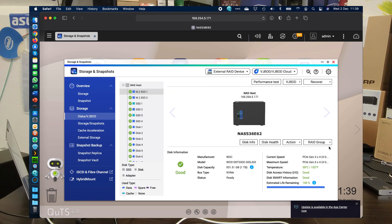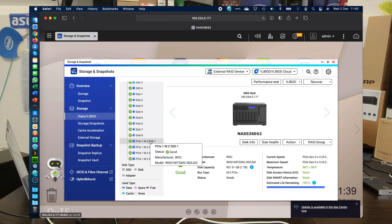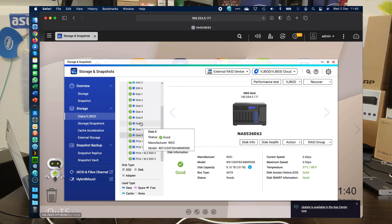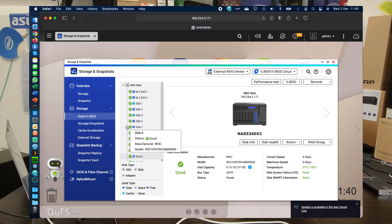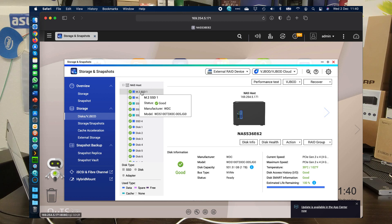Going into the discs, you can see all of these different groups together. We've got four NVMes on a dedicated QM2 card, all in one RAID array — that's a RAID 0. Then we have all of the traditional hard drives — eight of them — all in a single RAID array. We've then got two more SATA SSDs, 3.62 TB, in a RAID environment.